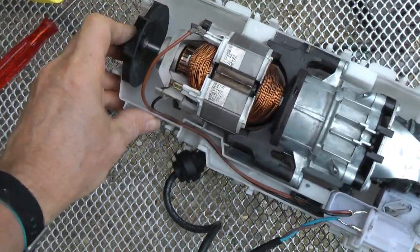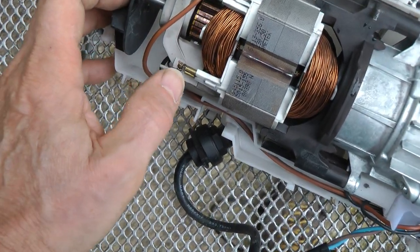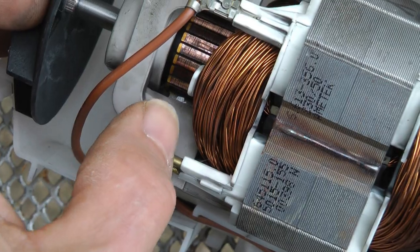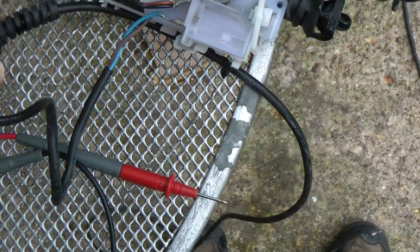All I did was move the brushes, and the brushes look good to me. I pushed them back with the screwdriver — you can see the mark on that one down there. The commutator looks good, so I don't think it's that. It's obviously something to do with the switch, or the mains cable's got a break in it somewhere. Difficult to know, really.